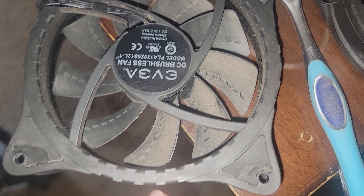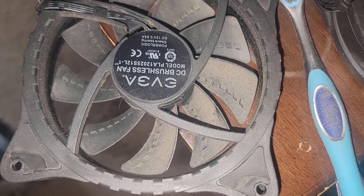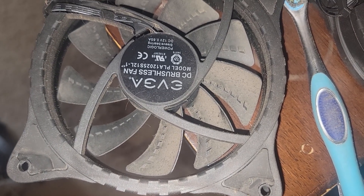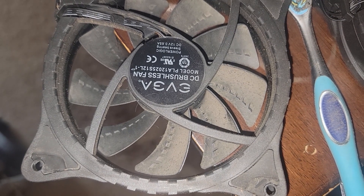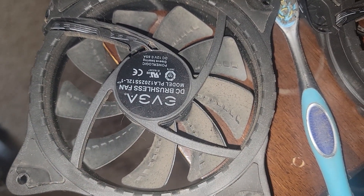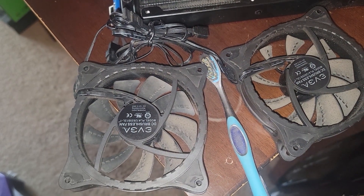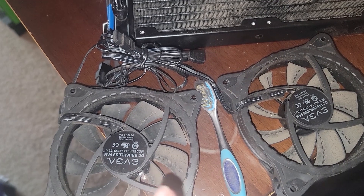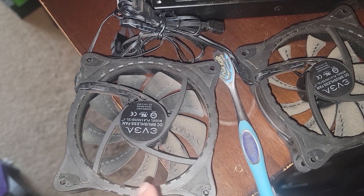With a little wet paper towel and maybe some Pledge that's safe for electronics, I'll clean each of these blades individually. When dirt builds up on the blades, it adds weight which can cause imbalance in the spinning of the blade and cause additional issues or wearing on the fan bearing. One of my tips throughout most of my videos: soft bristle brush, Q-tips, a little rubbing alcohol or some Pledge safe for electronics cleaning.